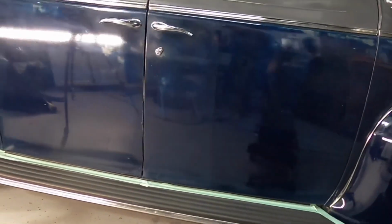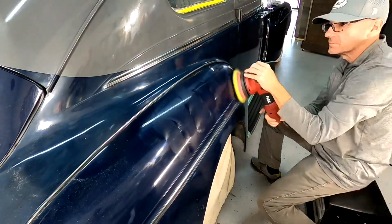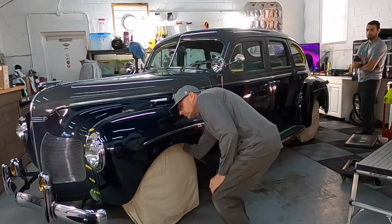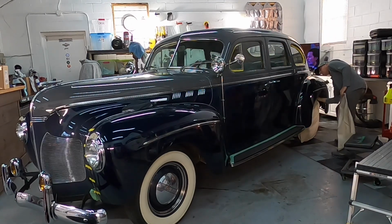freshly painted, where there was purposely enough material left behind, you can wet sand, you can cut, you can step down to medium and finish and really go to town and refine and jewel the overall finish of the paint and get it looking like a mirror if you wanted to. But that's becoming a smaller percentage of the owners these days who want to keep that original paint.